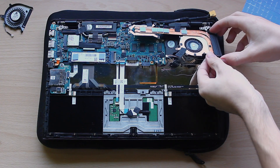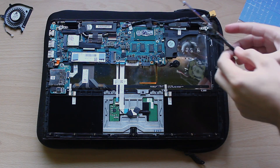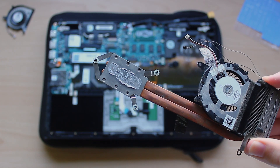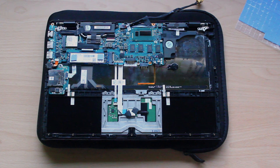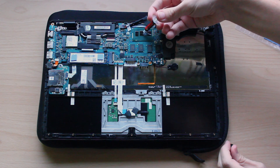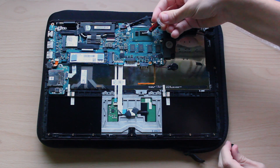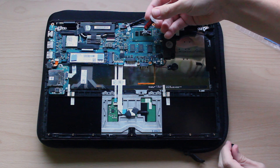If you want to go even further, you can replace the thermal paste on your CPU and GPU. I did this last time and I'm doing it again, but I don't know if I would recommend it. You get a small improvement in temperatures but you're also putting in a lot more effort taking your laptop apart, plus the thermal pastes you buy are made for best performance, not longevity like the stock one. That said, if you're already taking your laptop apart to replace the fan and you see the paste is dry, replace it — clean what's already there and drop a small bead of thermal paste on the CPU and GPU. It's better to overdo it than add too little, but don't go overboard.